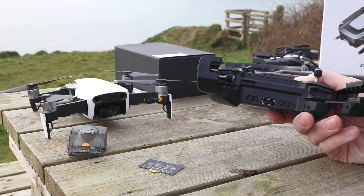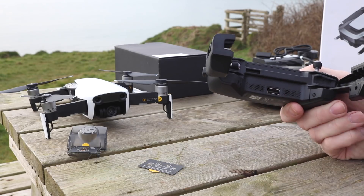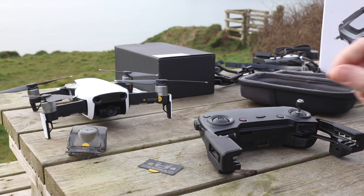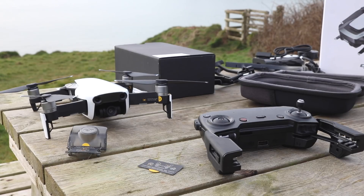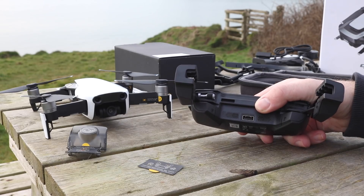The aircraft connects to your smart device via USB, just like the Mavic Pro. Unlike the Mavic Pro, the Mavic Air does not use OcuSync — it uses something DJI call Enhanced Wi-Fi. This new version gives a stated range of up to four kilometers in FCC and two kilometers in CE. It still has a 720p HD low-latency connection and in my experience the connection is extremely stable and more than adequate for an aircraft of this size. I've had no problems flying behind buildings, and while it may not give the absolute range of the Mavic Pro, it provides a much better connection than you'd see on the DJI Spark or Phantom 3 Standard. DJI have also increased the width of the device holder, meaning you can fit slightly larger phones and tablets slip in a little bit easier.